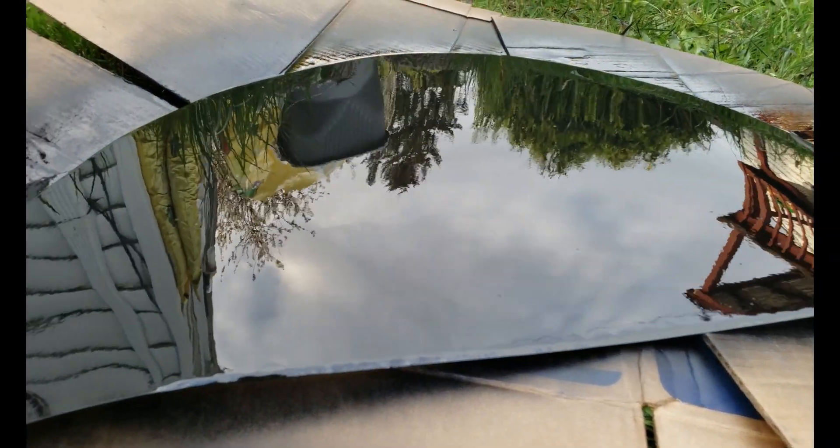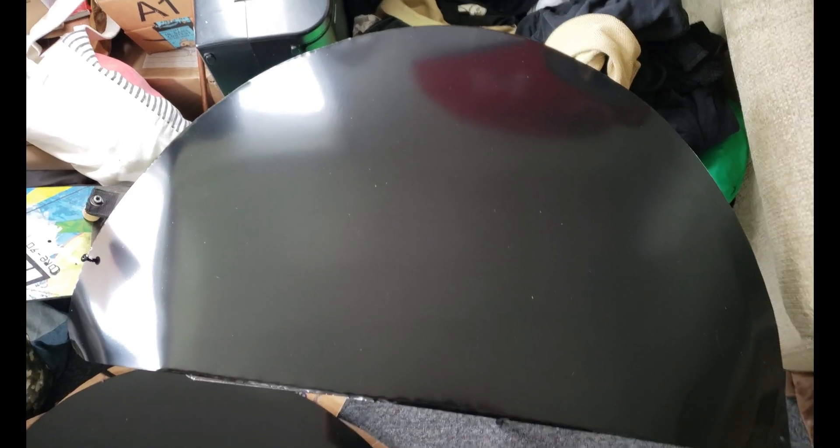There's already a bunch of dirt in it, but it's pretty glassy. Not perfect, but not terrible. I've got the dust coat on — always, always do a dust coat, or else your stuff's not going to paint as well or stick as well. It actually turned out pretty good, it's really flat. That one's got a few dings in it from the sheet metal work, and some dirt, but it's fine. The Prius looks much worse than this, so it'll be good.